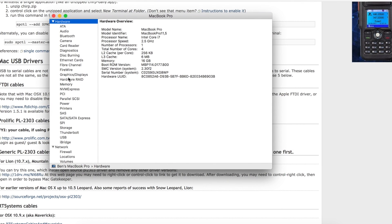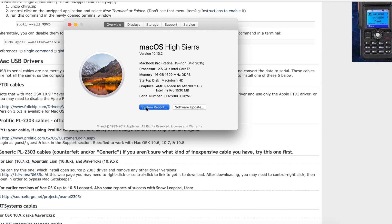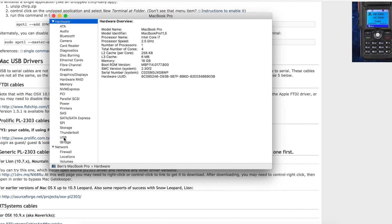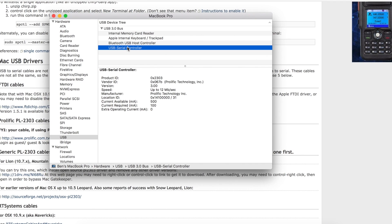In my case the cable wasn't being recognized by my system. I'm going to show you several things I did to fix that. On a Mac you can go into the System Report — similar to a Windows computer — and look at your USB to see what hardware is connected. In my case it was a USB to Serial Controller, specifically a Prolific Technology cable. It did not work right away, so I had to uninstall the default Prolific driver that came with the Mac and reinstall the updated Prolific driver from their website.